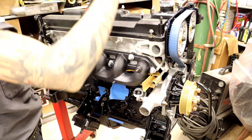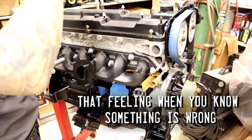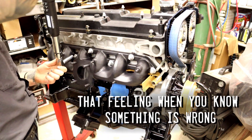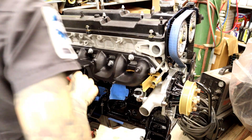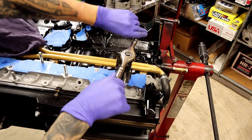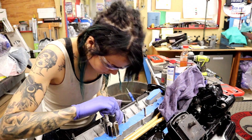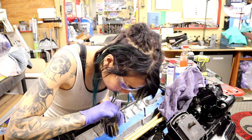Actually, that went horribly wrong. As I was tightening all the studs down to specification, every single stud that had not been helicoiled stripped out of the head — aside from one. I figured if they all do, I've got to do every single one of them. So I went ahead and helicoiled them while the motor was still assembled. It was absolutely so stressful, and it took about half of the day to drill out five exhaust studs.